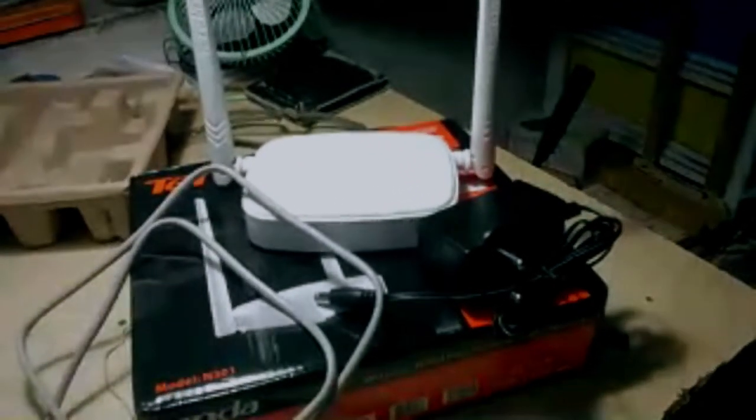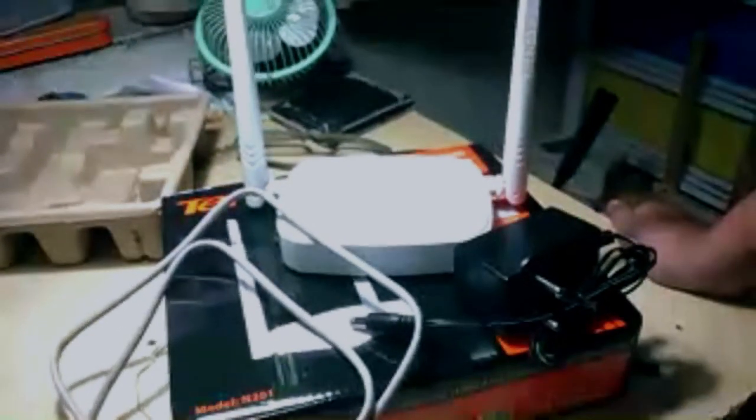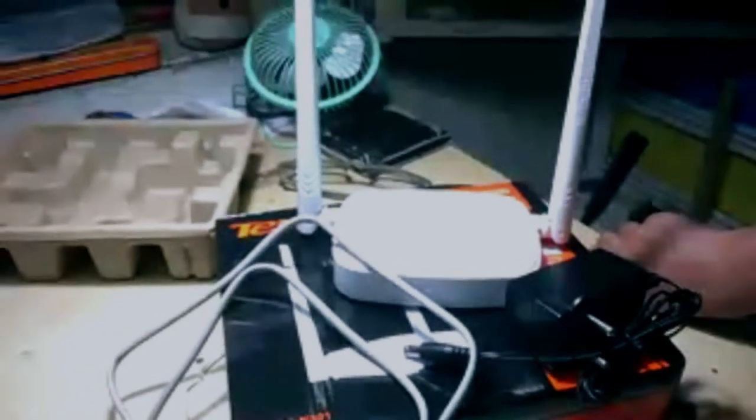With the magic of Prime you get it in one day. Inside the box you get a small, light router — literally very small and light compared to my old router — and it's filled with features. You also get a charger and an Ethernet cable. By the way, there is no information about the version of the Ethernet cable — whether it's Cat 5e, Cat 5, or Cat 6, nothing is written on it. Assuming the router handles 300 Mbps, you should get around 100–300 MB data transfer, but the cable is also not shielded, so it's only good for indoor use.